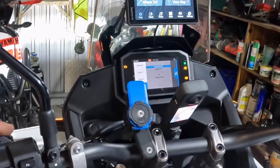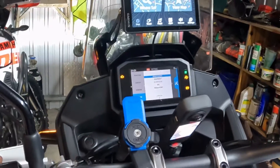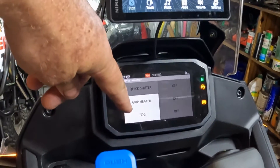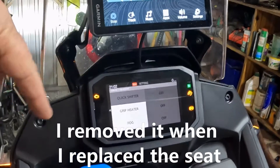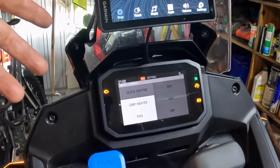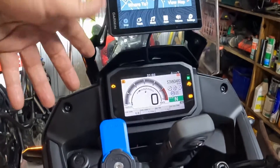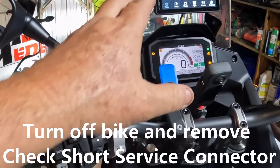Navigate across to the Equipment section using the toggle — push it to the right. It's gone white, it's recognizing it. One click down and you're on Equipment. Push across again and there we have it — you've got Quick Shifter, Grip Heater, and Fog Lamps, all currently turned off. It's not recognizing anything right now because I don't have the check service connector on the bike. If I did, it would show Quick Shifter on/off, Grip Heater on/off, or Fog Lamp on/off. From here, go across to the toggle, push right to reach the off button and toggle up and down. Note it will time out if you leave it too long and go back to the main screen. Once you've made your selections, back out using the toggle, holding and moving back to the beginning, and you're set.